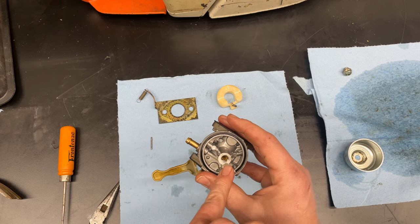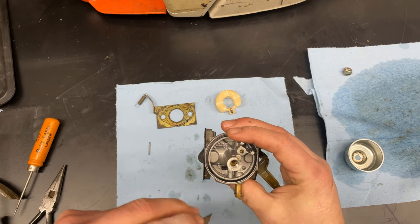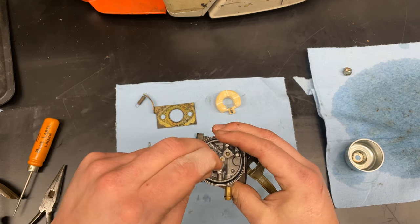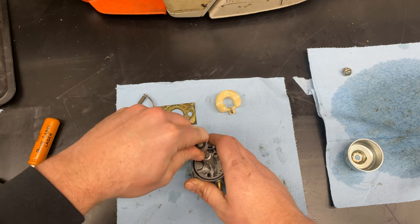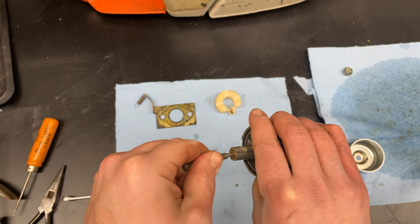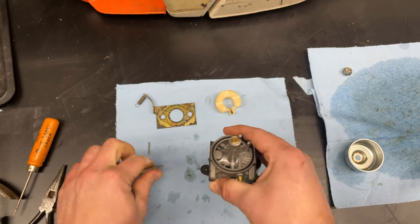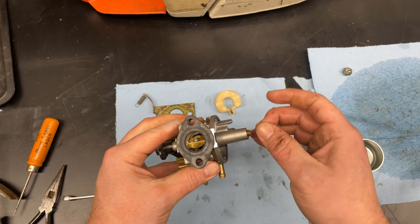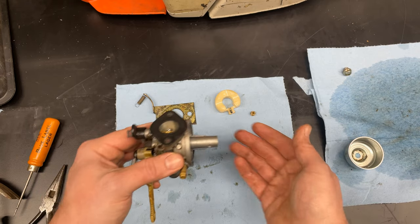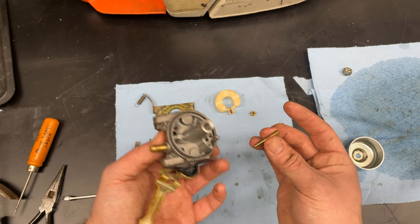When it raises and lowers it opens and closes the valve. Down in here is the jet — we're going to need to take that out too to clean it. The best tool I've found to get in here and get onto both sides is a drill bit, a flathead drill bit. It should just sit right down there — index it properly. Even this bit is a little wide. Pay attention to how this jet comes out — it sits down with the flat part to the bottom. Inside is the emulsion tube and it goes in with the longer end to the bottom.